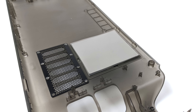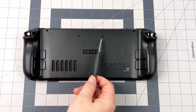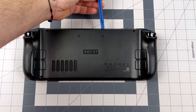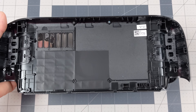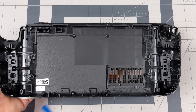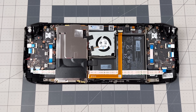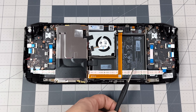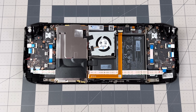I'm actually really interested in this for modifications down the road. Getting this installed is super easy — they've got a full video over on their website if you want to check that out. First thing we need to do is remove the eight screws on the back of the Steam Deck to get that shell off. It does come with a screwdriver and a spudger. We're going to get the clips from the top and pop it off — it comes off pretty easy once those clips are detached. Taking a look at the stock rear shell: nothing too fancy, we've got our ventilation and those rear buttons clipped in. There's actually no extra thermal conductivity on the rear, which I understand — they didn't want the back getting super hot. But it's going to make contact with the heat shield for the CPU. We've got our fan and battery. A lot of you have probably seen this before — you can go to iFixit to see every screw you need to take out to get it completely disassembled.